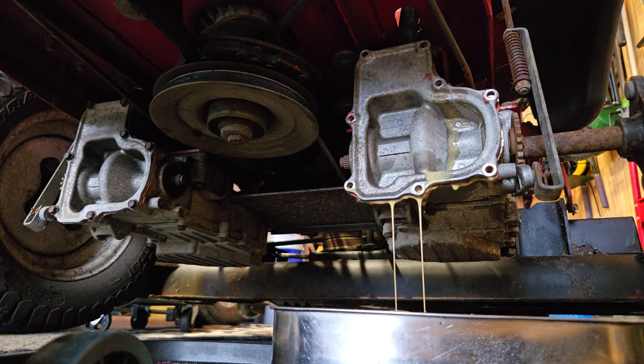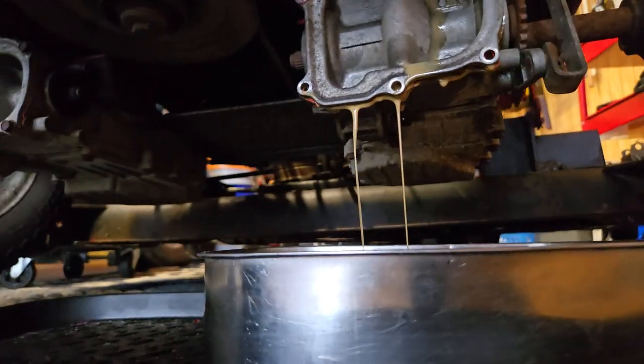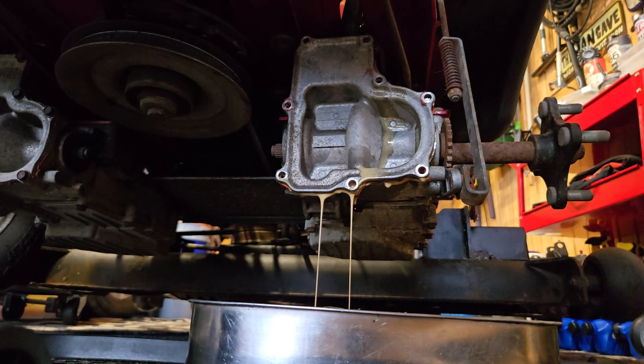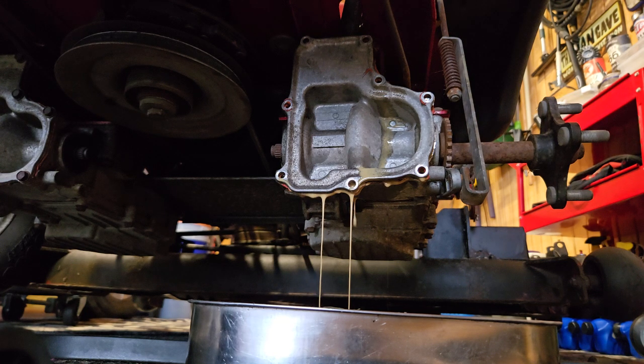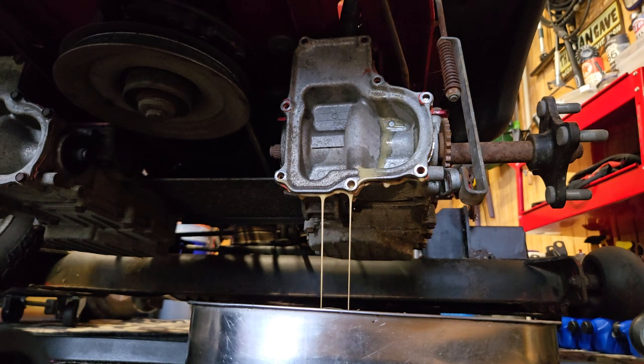So every time I jump on it I can look and say okay, it's ready to go. On this model I stuck a new muffler on it — I got this mower free. The muffler was cracked, I found one online, painted it black, and mounted it with a new clamp. I set the valves on this. It's actually a really sweet deal — the guy who had it before gave it to me. He even had the deck welded up with new heavier-duty framing on the inside. I have a big lot across the street — with my other little rider it takes me about an hour. Now I can do it in 20 minutes with this cut.